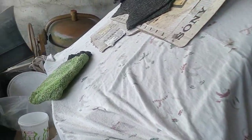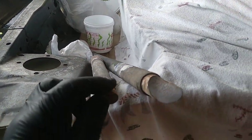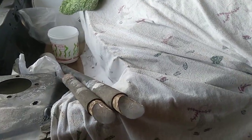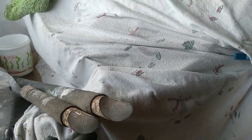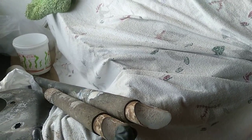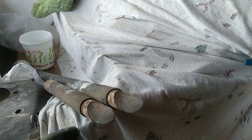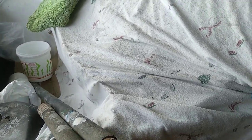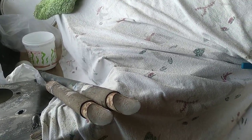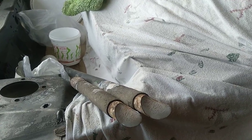It was the torsion bar that broke. I thought at first maybe the torsion bar had some corrosion that passed through the bar, but no, it did not. My guess is — you metallurgic guys can tell me — this bar is nothing more than a bar that is twisted when it's being built and treated by heat. This bar can only work in one position. It can only work clockwise in relation to the direction it was twisted when being built. If you take out this bar and put it in the wrong way, I think this is the result.